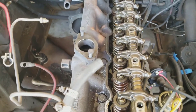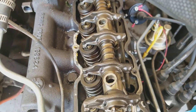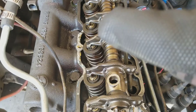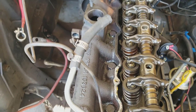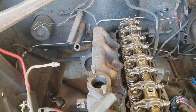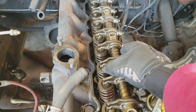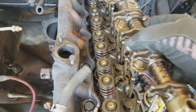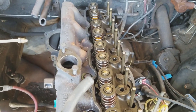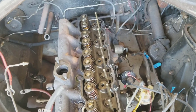I've gone ahead and pulled the bolts out of the rocker arm assembly. I've heard you have to be careful pulling those out because they're under tension and you can warp the assembly. What I did is loosen each one a little bit at a time gradually until they were all loose. Now I'm going to pull the rocker arm assembly up — try to leave the push rods in there — and there we go, one rocker arm assembly out. Next step is to pull those push rods and remember the order they were in, since they should go back in the same order.